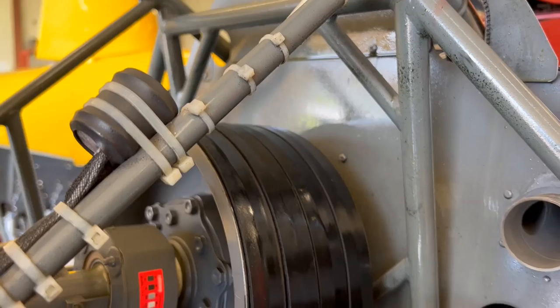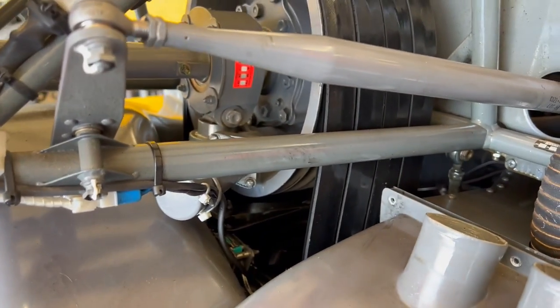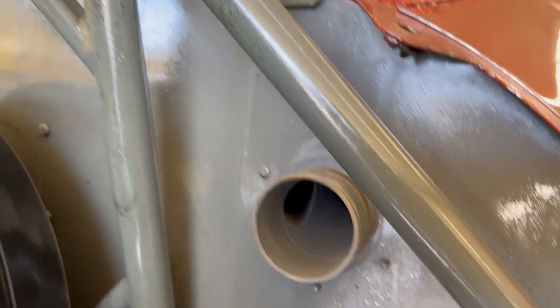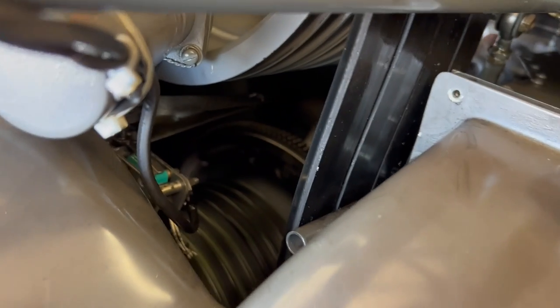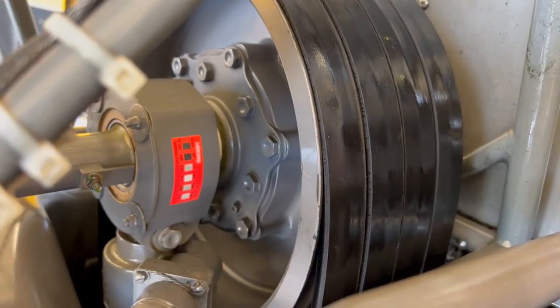The aircraft had a little over 600 hours on it and had one heck of a leak. So let's take a look at that. This aircraft came into the shop with 647 hours on it and you can see where it was slinging oil. If you look along the back of the bulkhead here, you can see oil all over the back of that. The belts are actually coated in oil. And where do you think that oil might be coming from? That's coming from the rear crankshaft seal.